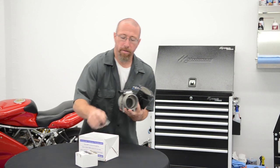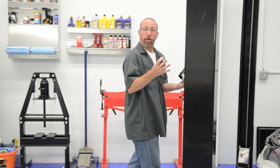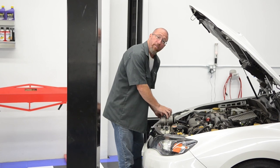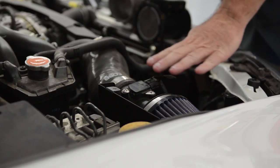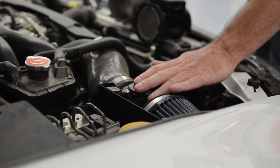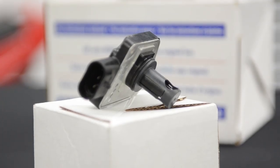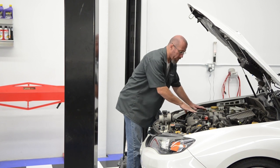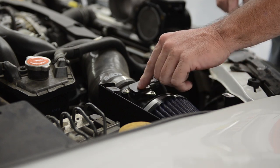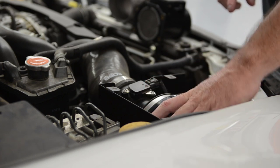You have the type that bolts into the factory piping of your intercooler or intake manifold, a type that works inline, and a type that bolts directly to the air box. On our WRX here, it has the type that bolts into the factory intake tubing. This particular one has an aftermarket kit from Cobb Performance — it comes with a silicone tube, a sample tube, and the mass air flow sensor bolts directly into the aftermarket piece, then the filter bolts onto it.